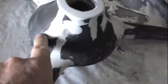Alright, here's the 31 wheel again. I applied more epoxy to all these and filled all these seams in, fixed all these crack lines. Now, I did spin this on a machine to get this to be even and precise all the way through. I have to do a little bit more filler through here and through a couple little spots here and here. I'm going to go ahead and do these little spots here. There's a little spot right here and right here and right here and here. I'm going to sand that and do those and run around this thing and probably spin it again to final off these last little areas. But if you could feel it, it turned out real nice. It's real even.